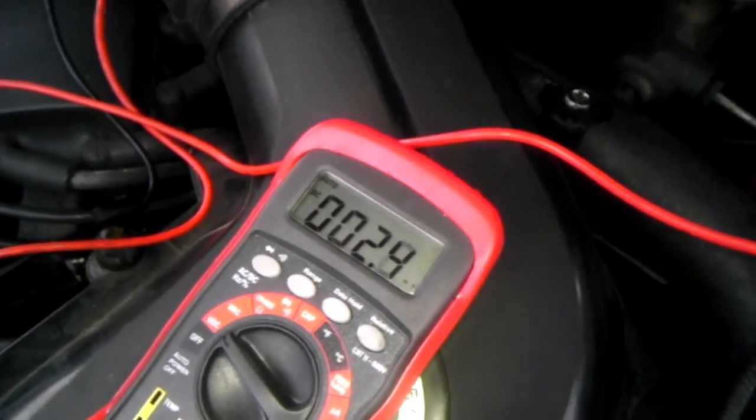All the lights were working when you turn the key to the on position, so I knew it wasn't the ignition switch. I could hear relays clicking. The starter relay on this thing is right there — the second one up on the left is the starter relay underneath the dash, held in by four screws.